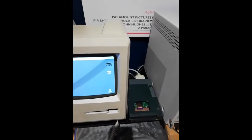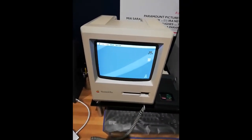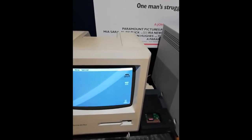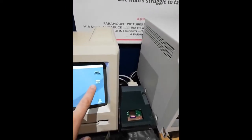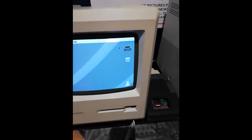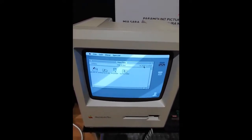What I have here is an SD configured with four SCSI disks — you can configure that on the SCSI2SD card. It has four volumes, each with a different SCSI ID. The first one, ID 1, is the Mac Plus boot drive; the next ones are IDs 3, 4, and 5. You have to format them and it takes a while. I only have two initialized right now — the Mac Plus boot volume and a spare one called SD4. If I open it up you can see the amount of disk space available.